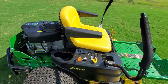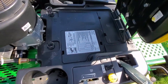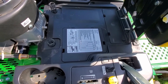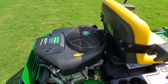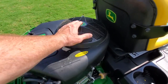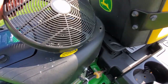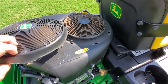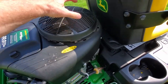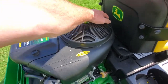The battery is located under the seat. If you raise the seat up, the battery is right there — easy to get to. The top cover on the engine comes off too. You see these little hand indicators — you squeeze them together and it comes off so you can clean that screen out and remove any grass that may accumulate in there, then it pops back on.